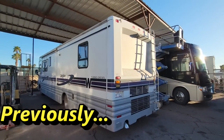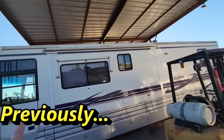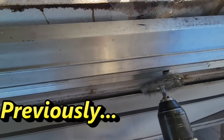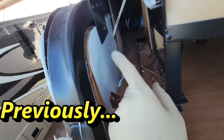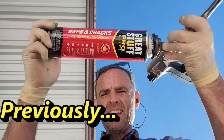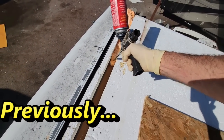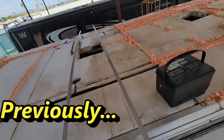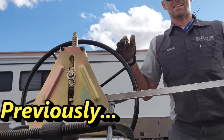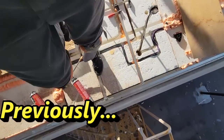What we have here is a 1998 Winnebago Chieftain, and there's an awful lot wrong with this one. I'm taking some construction adhesive and dealing with a collapsed sidewall right here. I have to get rid of the bad areas. I'm going to use pretty thick-walled square tube aluminum here so we'll be able to walk on these supports.